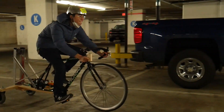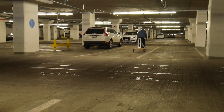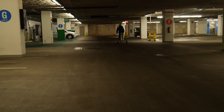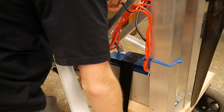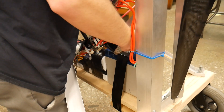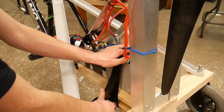The first test was an overwhelming success. Me and my friend both had a great time riding the bike — it worked great. But the problem was it could go faster. I was only using a 30-volt nickel metal hydride battery. When I tried my 42-volt e-bike battery, it kicked into current limiting mode — the BMS did at least — and it shut off. So it was time to put more power on this thing. I found a lead-acid battery and put it in series with the nickel metal hydride battery. They're both in series and can handle a similar amount of current, so this is perfectly fine, giving me around 45 volts to work with.